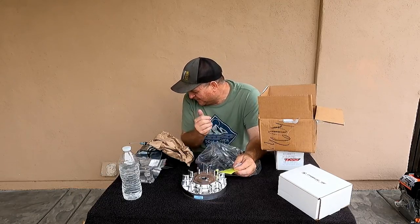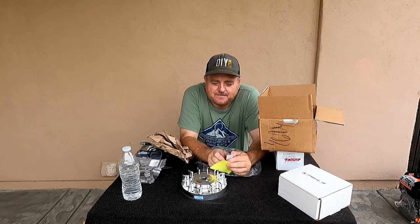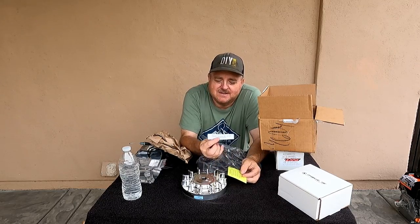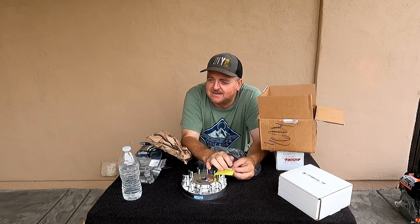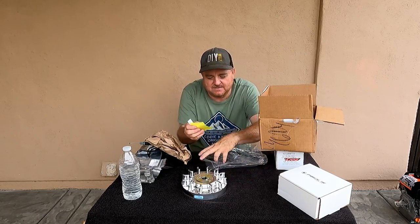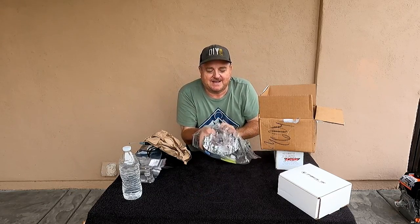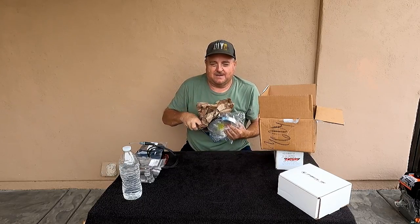Or actually, Paul's Karts hot coil recommends 65 thousandths because of the quality of the coil, and I guess it's the extra windings in it. He recommends 65 thousandths. So this says 30 thousandths. I've got Mighty's coil right now set to about 60 thousandths, and it runs great. So I think we're heading in the right direction with these parts, and it should be another fantastic engine build. Like I said, this has all been done before. I'm not doing anything new.